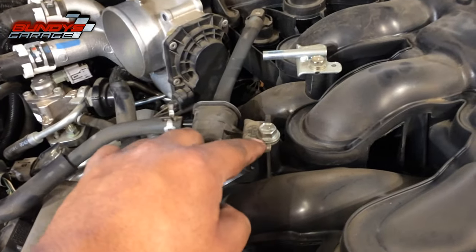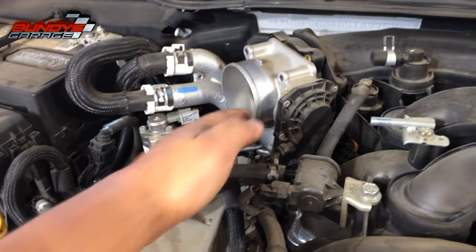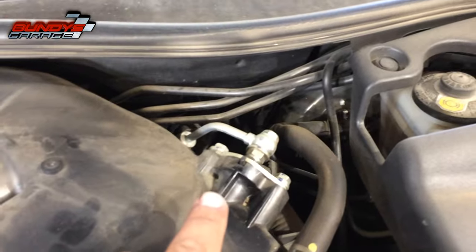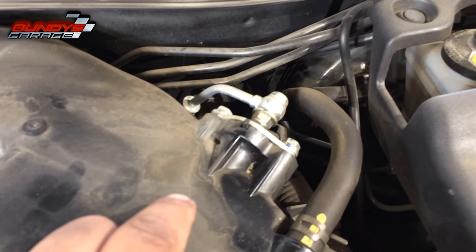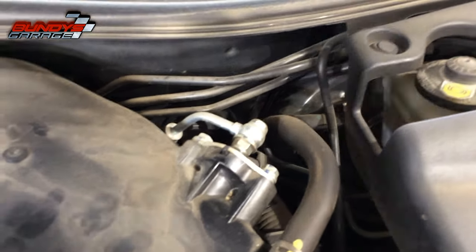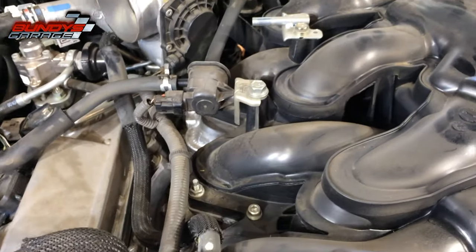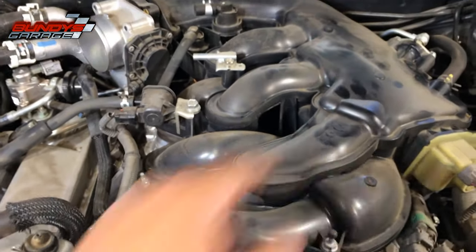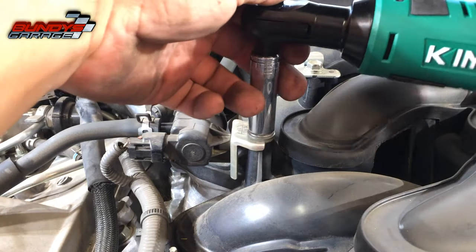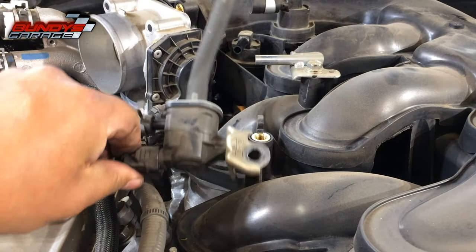There's a hose going in here; we'll take that out and take this bolt out. I'll put this bolt back in the intake so I don't lose it. I'm not going to disconnect the wiring harness for the throttle body at all — this is a fly-by-wire system. Over here there's a fuel line with two crush washers. Whatever you do, don't lose those. You can typically reuse them, but if you replace them buy them from Toyota. Get these nuts off and these allen screws, and the intake should be ready to come out for access to the driver's-side spark plugs — 12-millimeter.